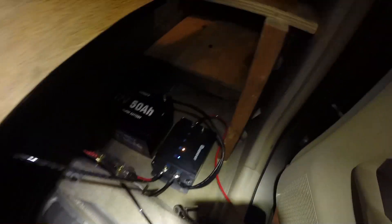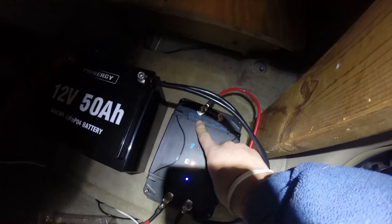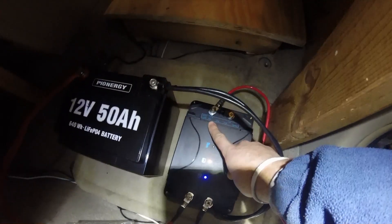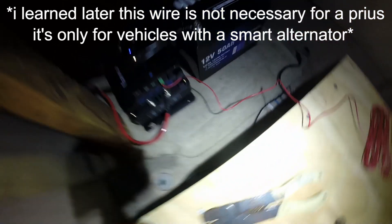The red and black wires come from the battery in the back. The negative connects to the common negative terminal on the charger, and the positive connects to the alternator/battery input — labeled as the ignition battery input. These two wires are on the back; the positive is connected here, and the negative goes to the ground. There's a 50 amp fuse placed close to the battery.